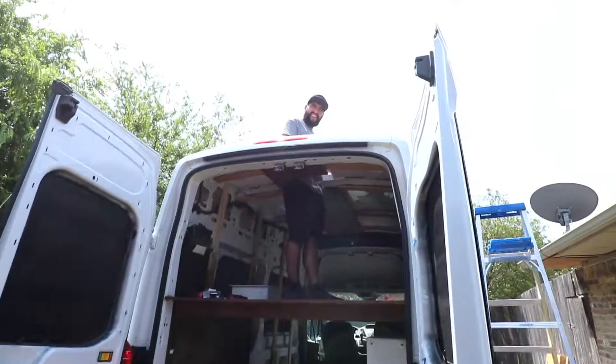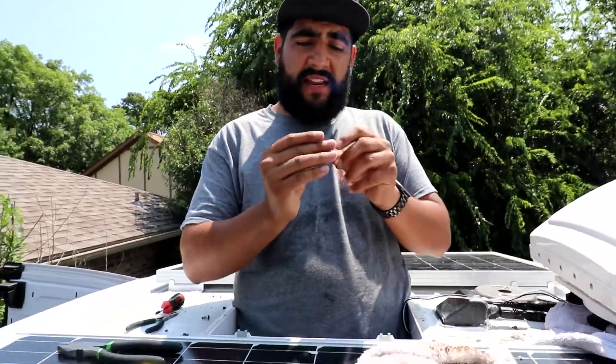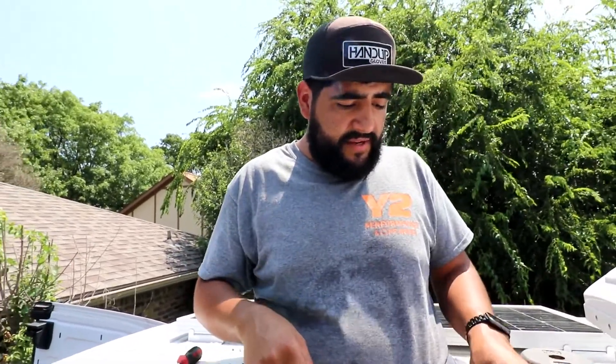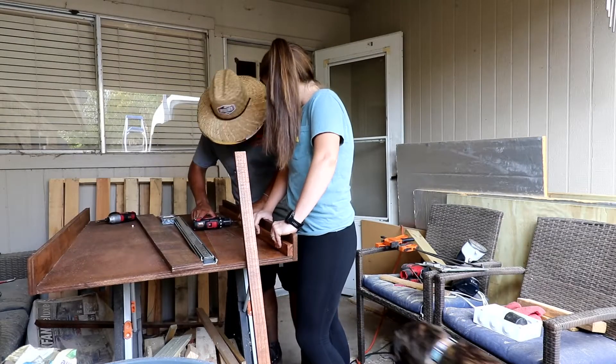HP is dealing with a Turo car so I'm going to try to handle this solo. I got the fan off and found a bunch of holes that aren't sealed. Picking out all the old glue — some of the screws show rust, indicating water was sitting there. I can see areas where, when I push down, water is poking out. I'm peeling off all the existing sealant and I think we should just reseal the entire thing — no point in building glue on top of glue.